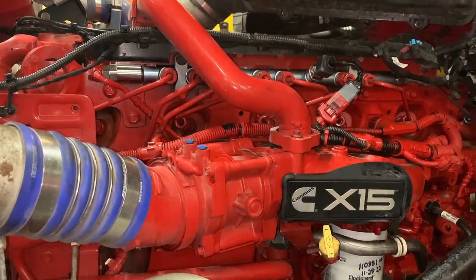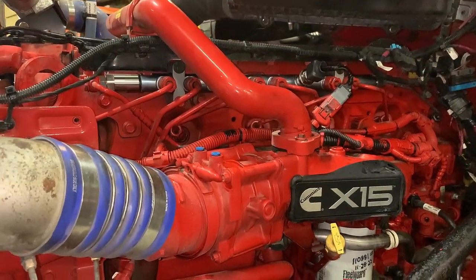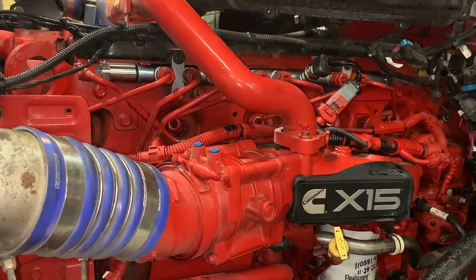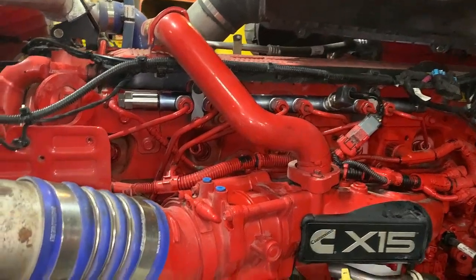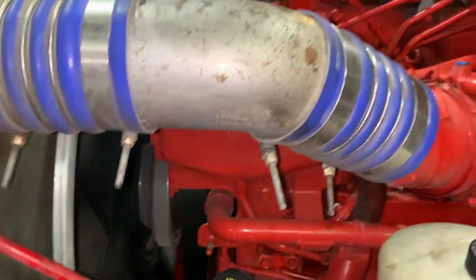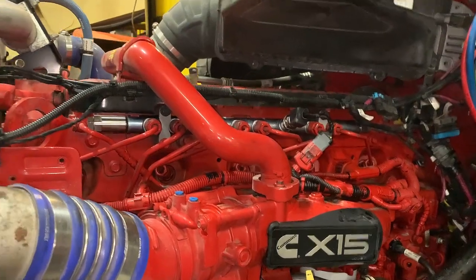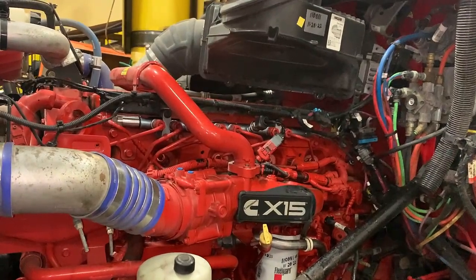We did not leave any fuel lines loose. We've got a new common rail that's completely empty, so the high pressure pump is going to have to fill that rail and purge all the air out of it — it basically pushes the air into the injectors as it fills. We had a total crank time of about 30 seconds before it finally started. That solvent down on the injection pump, we just had to blow it off. She ran good, and there were no leaks. It was a good repair job.